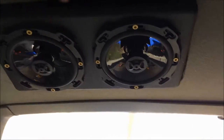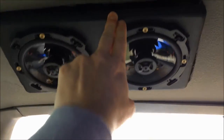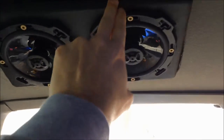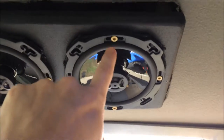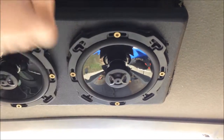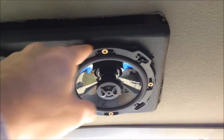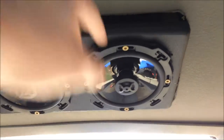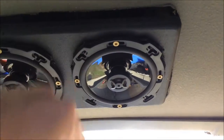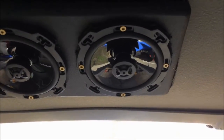At the bottom it's bolted inside there to the factory location. I want to see what I can do to glue or secure that a little better. Maybe I'll put a little Gorilla Glue right there. I'm going to keep tearing these apart. As is me, I use a deck screw - nice thing to go into plywood with. But I would caution: be careful because these attachment rings for the speakers are actually plastic. You don't want to drive too hard and crack them. And obviously driving that close to the speaker surround - if you rip that foam you might as well toss the speaker.